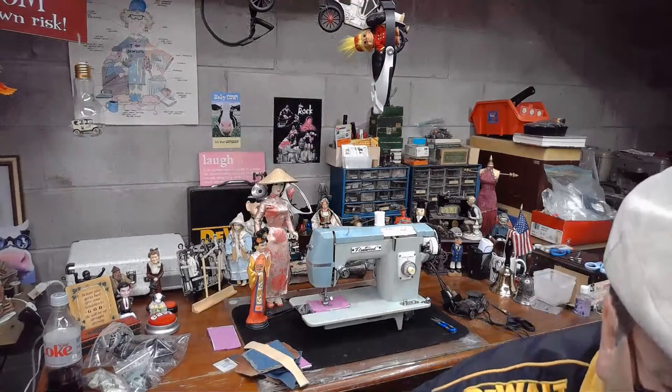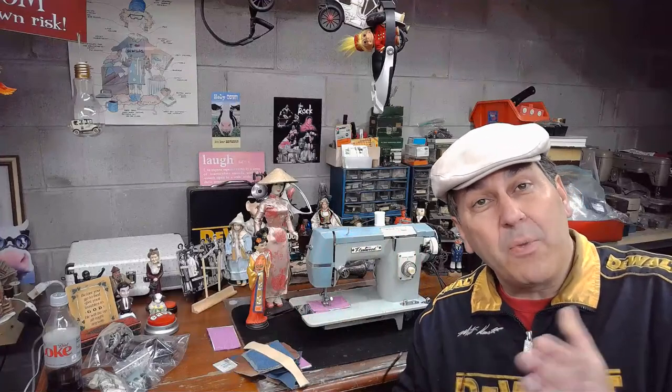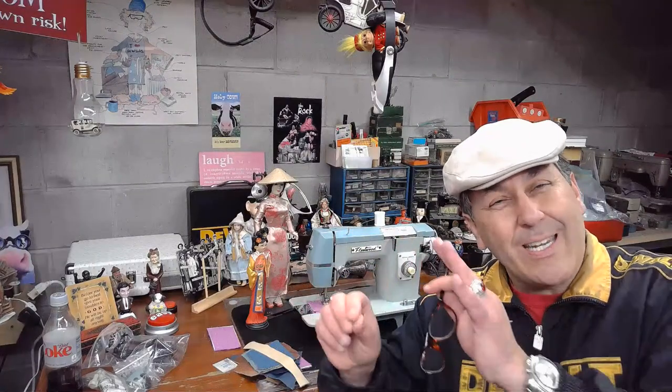Yeah, Roz is correct as well. The cracking issue. That's the only problem with cast machines: when they cast them, they're dealing with a very hot material. And as that material cools, it leaves tiny little pock marks throughout the casting that make it vulnerable. You guys remember that machine that came out of Texas? It was a 130-6, and it snapped that leg off. And I showed you guys step by step how I finished that repair, just like that other machine that we recently unboxed from Montana, where the back of the bed was completely snapped off. It had been dropped on concrete in a driveway, I believe, is what the customer told me from Montana.